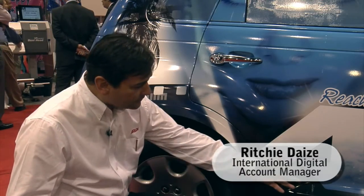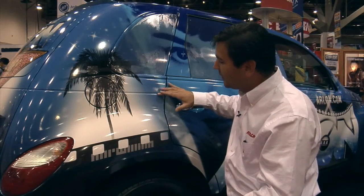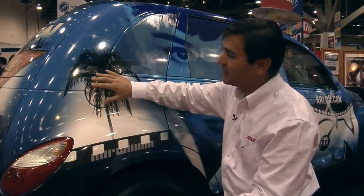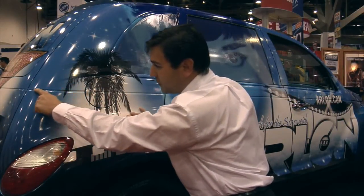From a media performance standpoint, some of the most difficult parts of a vehicle wrap application are areas like here and here. We're taking the vinyl and trying to force it into deep channels or wide channels and make it stay. In channels on a vehicle that look like this, we would rather you set the vinyl into the groove by installing all the way through the channel. But when you come to spots where the channel ends, something else happens, or the channel goes around the corner of a vehicle — that is impossible. We have no choice but to first bridge the gap and then set the vinyl into the ridge.